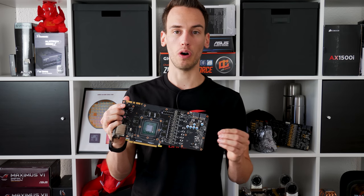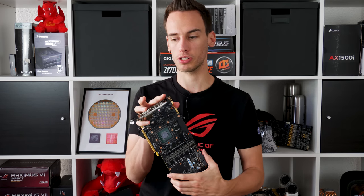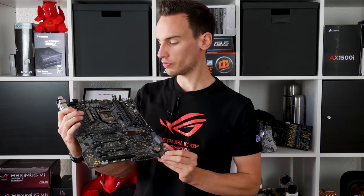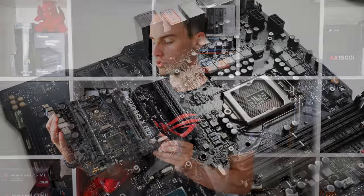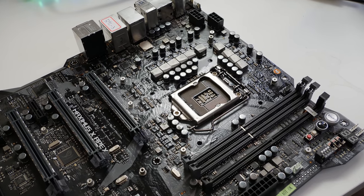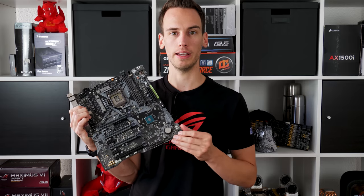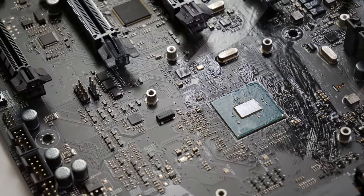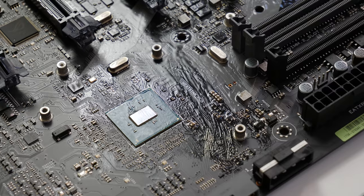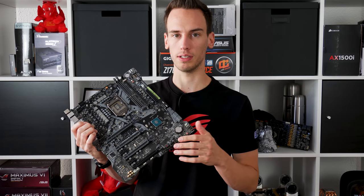To prepare for the dishwasher, we remove all unnecessary components. The VGA is already stripped down for extreme overclocking so nothing needs to be done there. For the mainboard — this is the Maximus 10 Apex — all unnecessary heat sinks are removed, even the PCH heat sink. A lot of people ask why I run the PCH naked. The PCH has a very low power consumption, typically between 3 and 5 watts, and that heat is easily dissipated through the PCB — no PCH cooler needed, even for ambient testing.